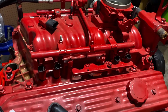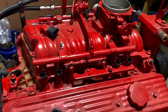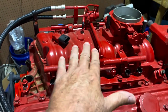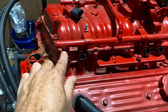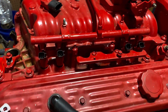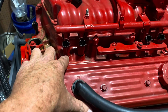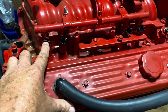This video is to let you know that in the future I intend to start selling the injectors you need to upgrade your 5.0 to a 5.7. I'm not going to gouge anybody — just a fair amount for my knowledge and time spent putting the kit together. To swap the injectors: take the rails off, pull the little clips that hold the injectors, pop the injectors out, put new injectors in, and put the clips back on. When you put the injectors back in, lubricate the O-rings on both ends with transmission fluid — ATF — and it makes it go in a lot easier.